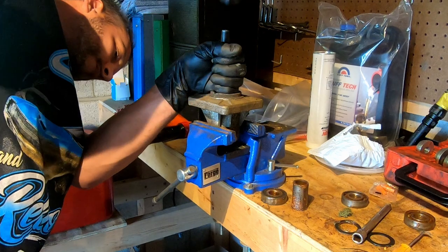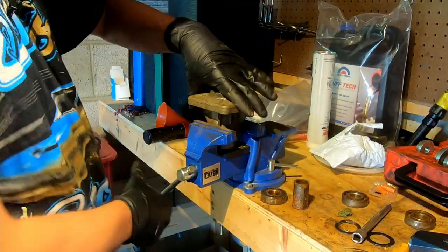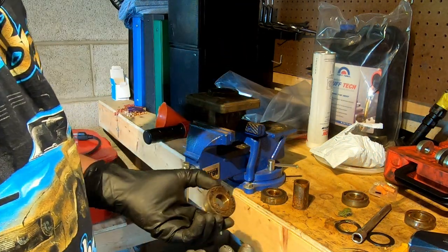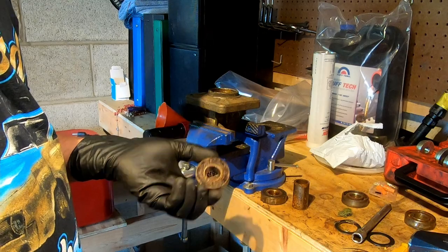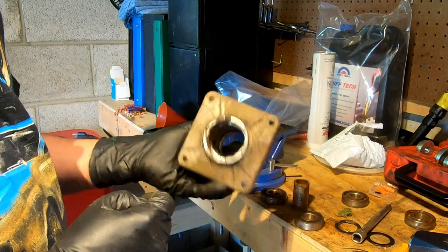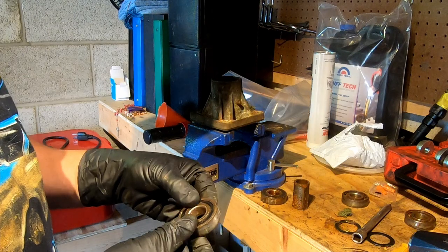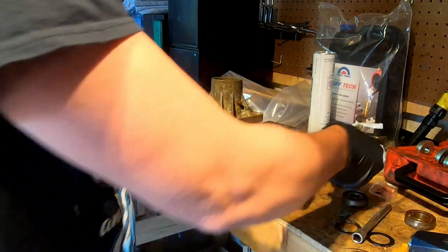You don't even have to look up the mower, because I don't think you're going to be able to get a good part number for bearings - they want you to replace the whole thing. MTD and places like that aren't interested in just selling bearings. The other thing: they put a grease fitting on this, so you think 'great, I can maintain it,' but then they put in a bearing that has a seal on both sides. So if you inject it full of grease, all you're doing is filling up a cavity - it's not doing anything to the bearings.